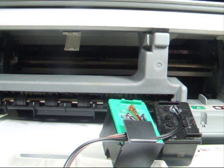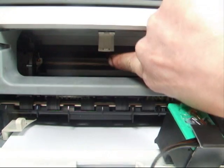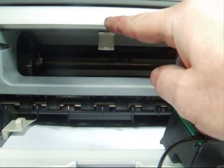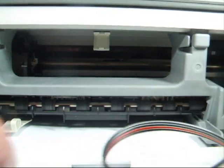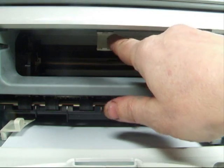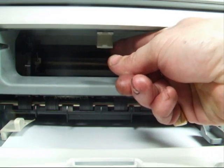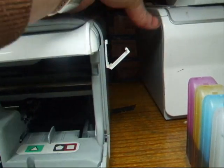It's quite an easy one to do. I've done some preparation here. You can see this here — this is the hinge clip. What you have to do is get approximately the center of the printer with the door down. There's a gray strip just under here and you stick the clip onto it so it angles like that. We're going to close that when we've got the piping in.